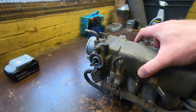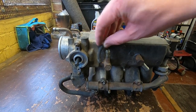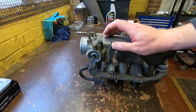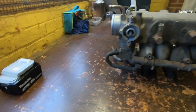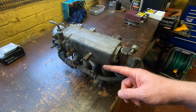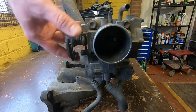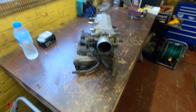This one I think is for the air conditioning - it's weird because it goes off to what looks like an air conditioning solenoid valve, and it's also got a smaller one on the bottom. Let me know in the comments if you know what that's for, or if it helps identify whether this is a Starlet GT rather than a Glanza. There's also an air transfer tube - almost like a vacuum block - where air is fed in, comes around the other end, goes into the idle air control valve, and through into the manifold. The throttle body is still on it - it's 50mm diameter, moves fairly smoothly.